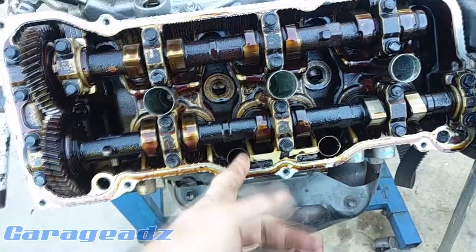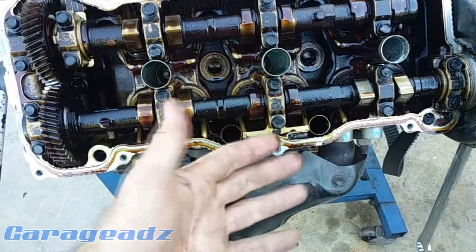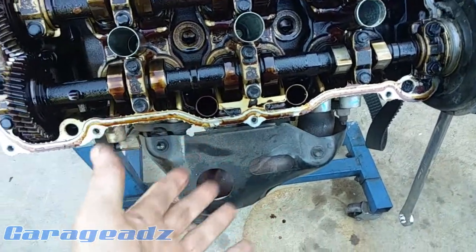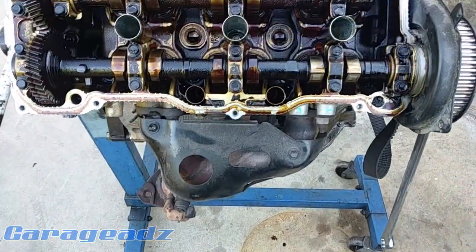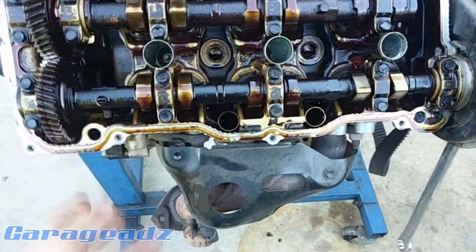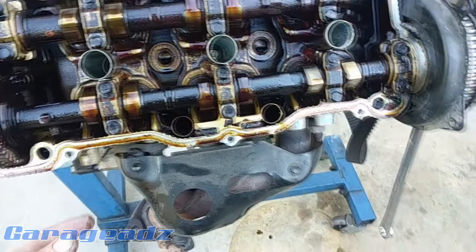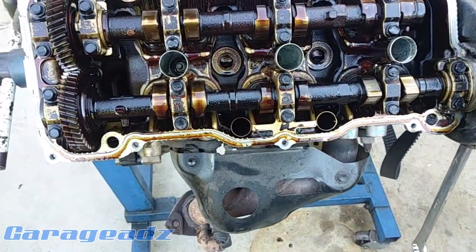What we're going to do is just delete these tubes. It'll mean that the oil won't necessarily bank up here — it'll flow all the way down into this here and return to the sump a lot easier. It just seems pretty logical. So we're going to do that, and hopefully that'll improve things. I'm still keen to put a drain in the side of the cover here, and probably weld to the sump before we put this new motor in.